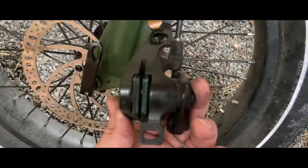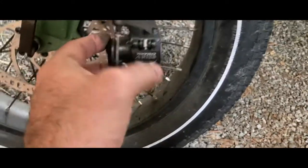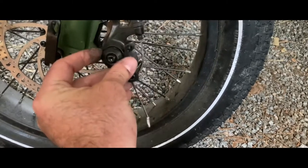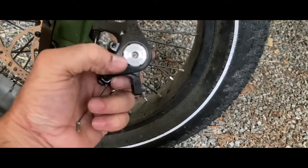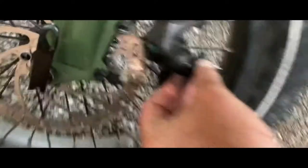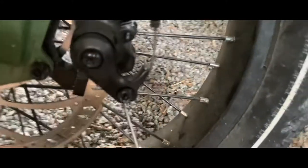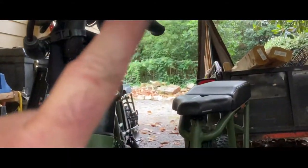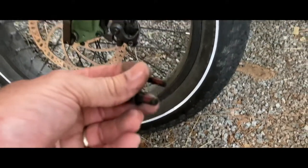My new fat brake pads are on. They even match the bike — green and green. Slap this baby back on. If you need to adjust in and out based on squeaks or how it's sitting on your bike, you can do that once you reinsert it — left or right from this little portion. Make sure you seat this back; it's magnetic, so line it up a little bit. Keep it a little bit loose until you test it out, and then once it feels pretty good, tighten it down and you can adjust it left or right. Just two bolts. Pretty simple. Hope you guys enjoy, thanks for watching.